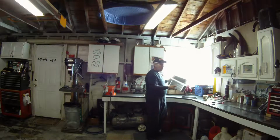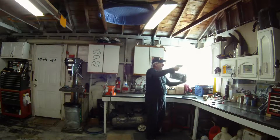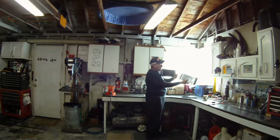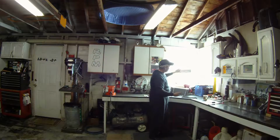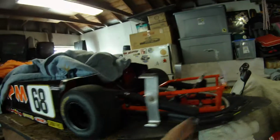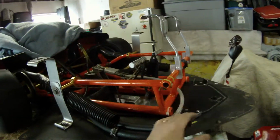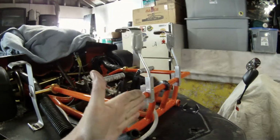This causes a couple different problems. This radiator's got fittings on the back side, right? Which we front back. This is front back. We have the fittings on the end of this radiator. And the problem that we have now is because this one is so much fatter, it's actually moved more forward. We can't move it anymore backwards because it gets closer to this bumper here. I'll show you. As the radiator gets closer to the bumper here, we got no room for the fittings, you know, the hoses to get to the fittings. So we have to physically move the radiator out, which caused a problem.